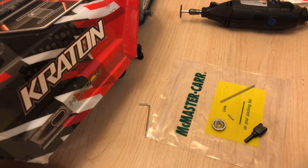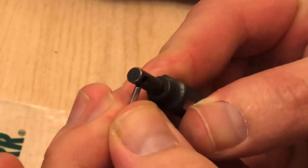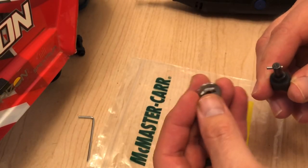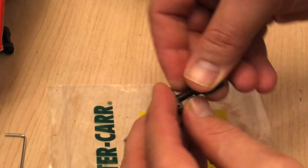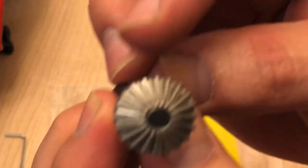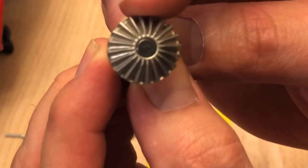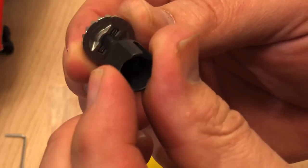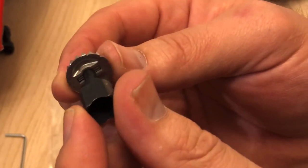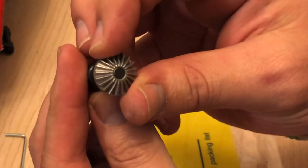I've been on the search for strengthening this component. One of the things I found to always be frustrating — if you take a close look at this little pin as you put it through the hole, there is just a ton of slop. In my opinion, based on physics, if you've got that much slop in there and you're sending immediate bursts of torque straight into these two planetary gears on both sides of the differential, you're going to increase the likelihood of snapping that pin exponentially.